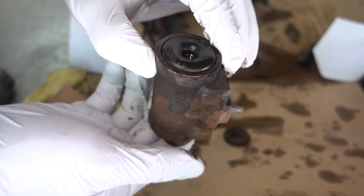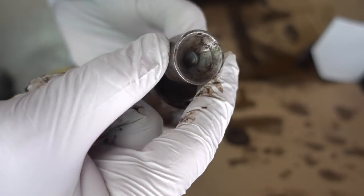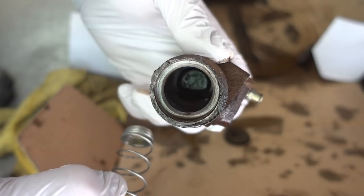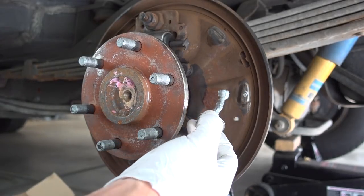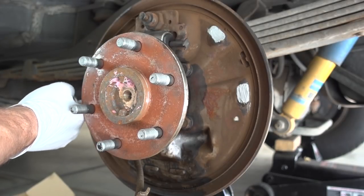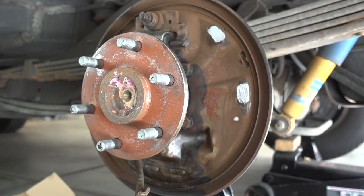If any of you guys have ever wondered what's inside of a wheel cylinder — you have this rubber boot here. Once that rubber boot comes off, you have your plunger. You have a plastic piece there and then a spring. Once the spring comes out, that's it — it's just a fluid reservoir basically. One thing I noticed while doing my research is there are contact points where the shoes actually rub against this backing plate, and I noticed people lubing it up. I saw one guy put anti-seize on there, and I thought that was a good idea, so I'm doing the same thing.